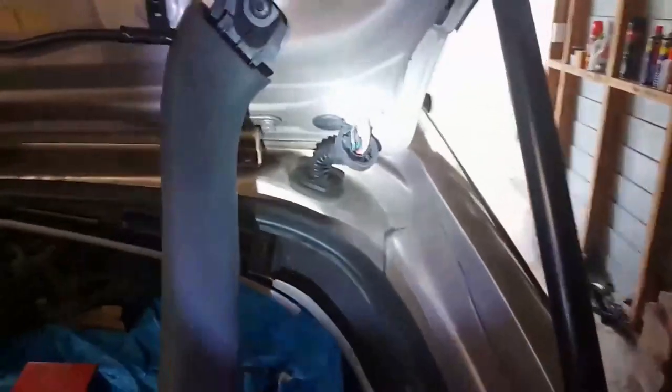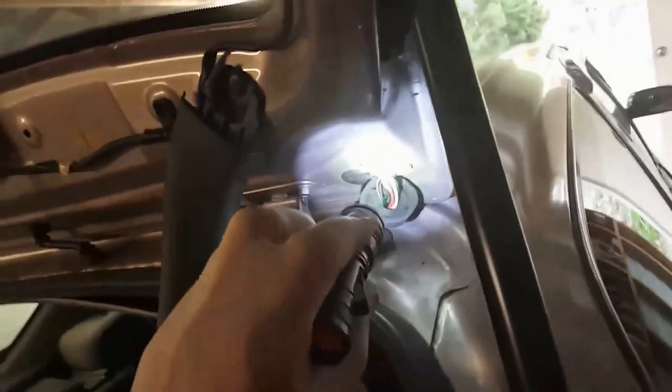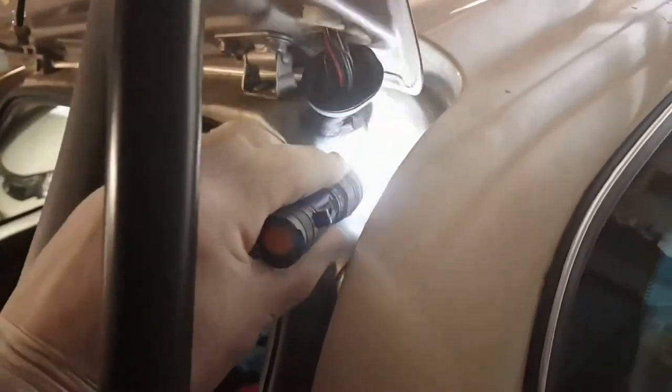Okay, it's a wiring issue — it's got to be in this region here. I'm thinking the problem is probably here. There's a fair amount of tension on these wires and they get squished down into this bottom region. It looks like possibly somebody could have been in this cluster of wires sometime or another. We can see down there that it's a little bit torn around there.